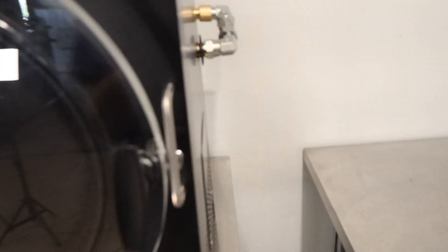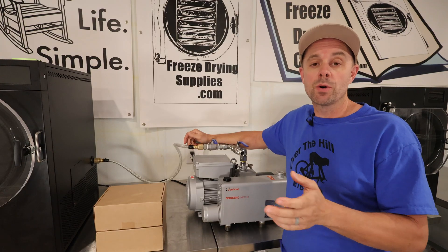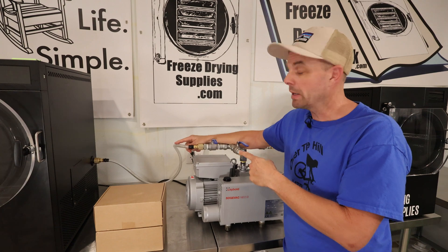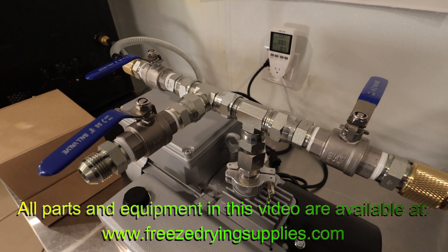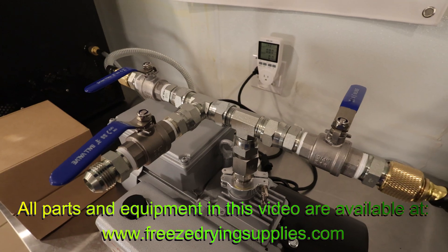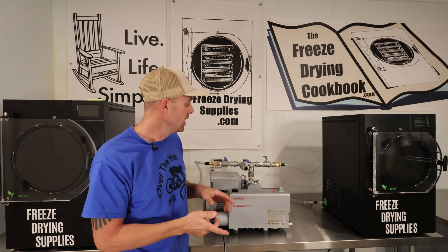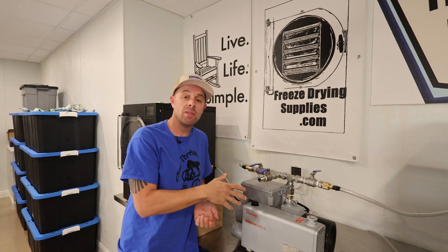This right freeze dryer we had to modify so the vacuum hose would round the corner, assuming you're going to use the factory vacuum hoses. You could make your own as long as they're reinforced hose like this. I used all stainless steel hydraulic fittings, though you could also do MPT brass — probably a little cheaper and simpler to find the parts. I want to give credit where it's due: this setup was actually created, as far as I know, by YouTuber Epicenter Brian. His looked almost exactly like this, so I've spent the last couple months trying to replicate it.